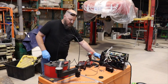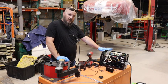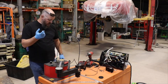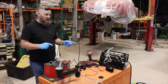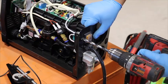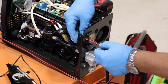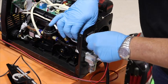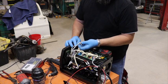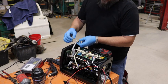So I'm going to grab some wire and we're going to connect the switch line here. What I'm going to do is set it up so I can use either the button on the plasma cutter or this wiring. We're going to go ahead and take these two wires here, which is the back side of this. We're going to cut them. We're going to crimp into them.